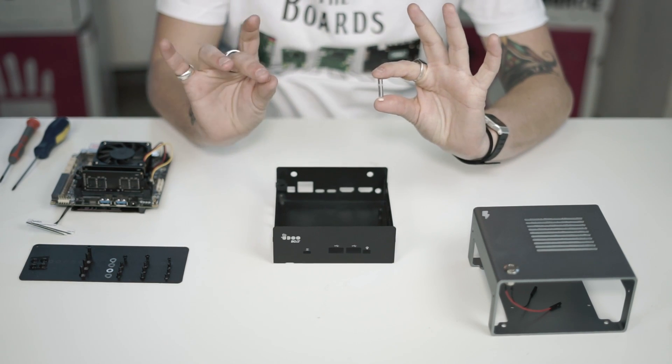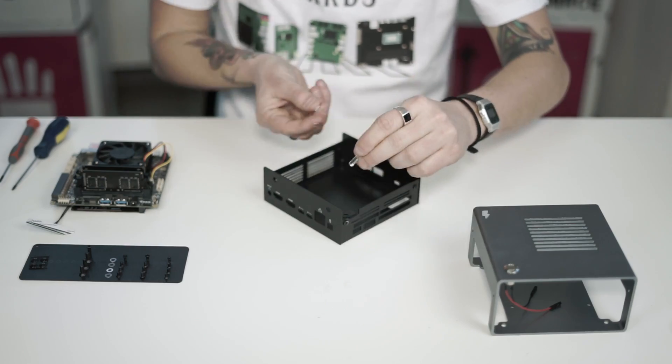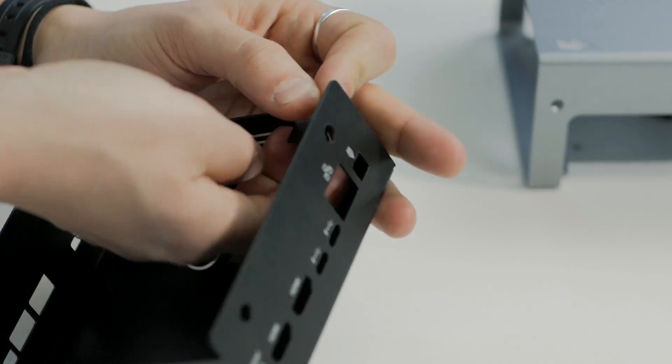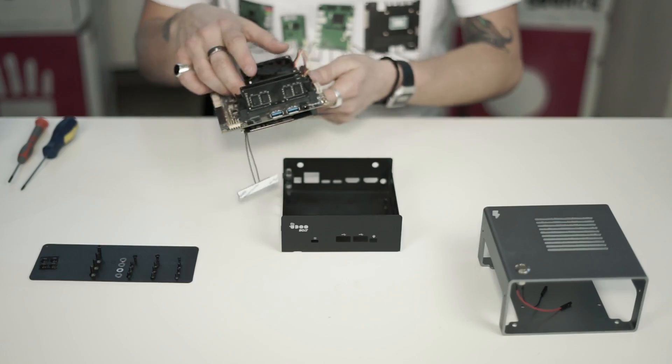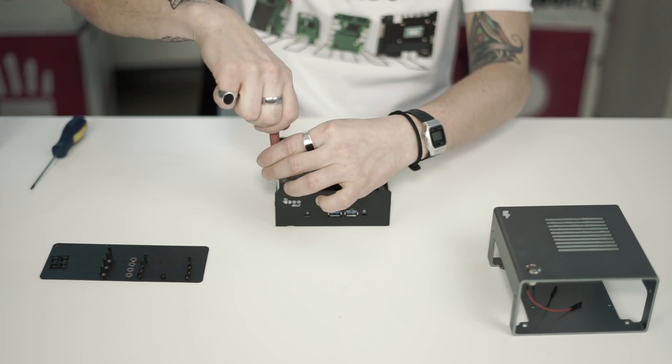It's highly recommended to insert the light guide first into the hole of the bottom black metal case and then secure it with the plastic rubber band from below. Make sure the longer part is below the hole. Then get the four non-flat head screws and tighten them in the four holes.